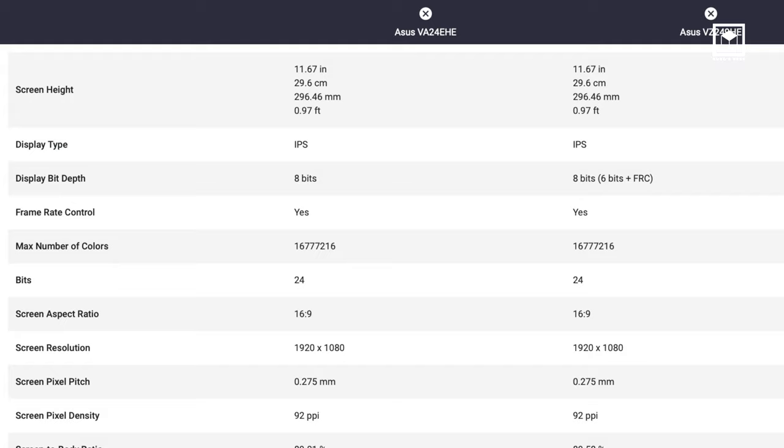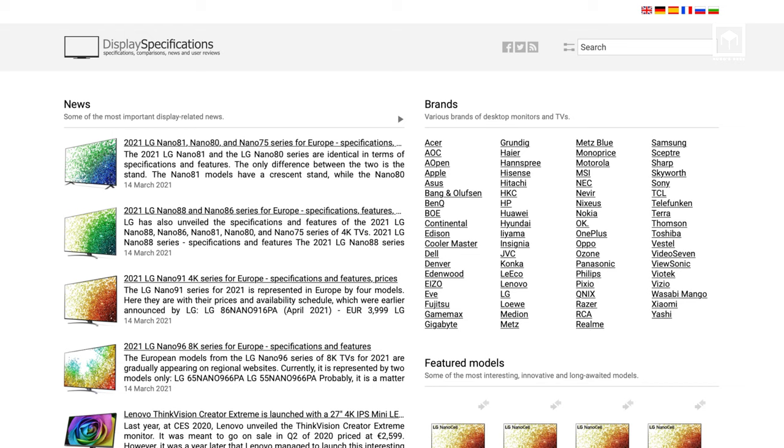To be honest, most 8-bit monitors are actually not 8-bit either. They are usually 6-bit plus FRC. At the end of the day, the monitor can support and display 1.07 billion colors. I wish it was full 10-bit. Of course, it would be awesome if it was like the old SW320, but I understand that it's an expensive thing to build. So always look at this spec. There's a lot of websites where you can research this information. Again, I'm leaving some in the description.